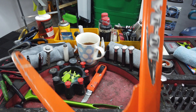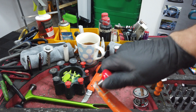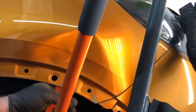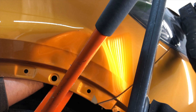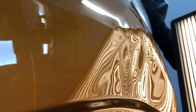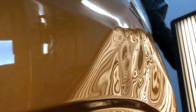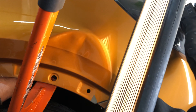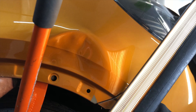Okay, let's get moving some metal. We've got the Dodar out with a slightly domed rubber tip on the end. This setup is going to help me move a lot of metal in a really good controlled way. You can really see how tough it is to move this damage — that crown at the top is absolutely solid. So by pulling this area out first it'll enable us to get the crown down a lot better. I'm getting there; there are a few other pushes — it's kind of expected on a bit of damage like this.